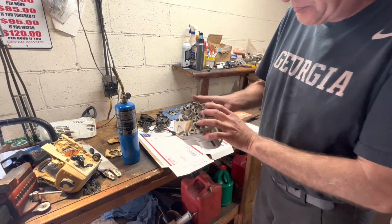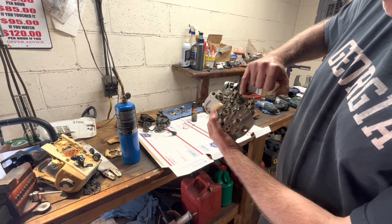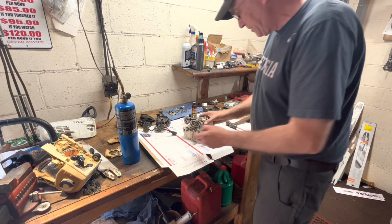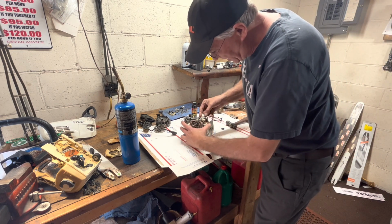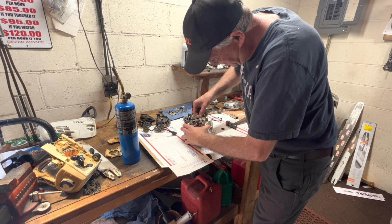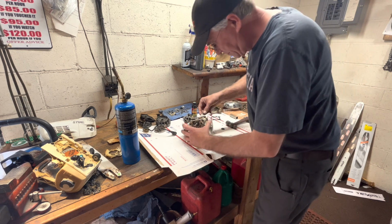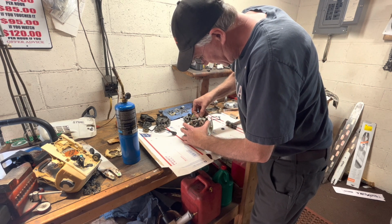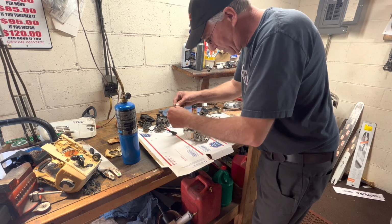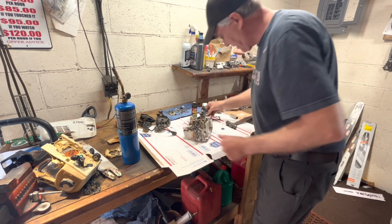All right, moving right along. We got the PTO side seal installed. Make sure you are flush to the surface and that it is even all the way around. I've already trimmed one side of the case gasket. Just take your razor blade and cut away from the crankcase so you don't have to fish out any paper. Feel. Make sure you got nothing right there, because that'll interfere with how you seat. One little burr right there, and go back. There it is. Now, that's slick as a minnow.